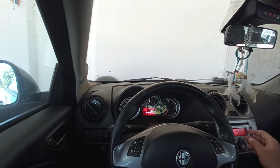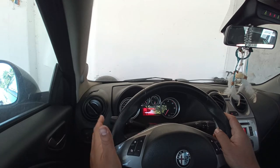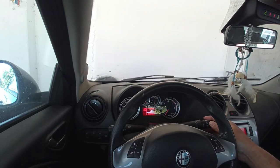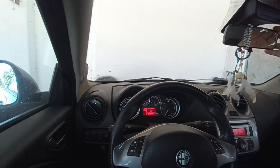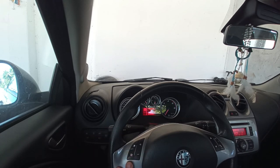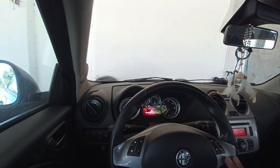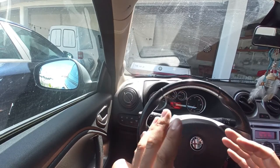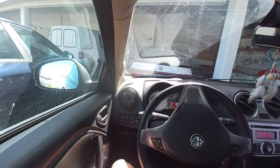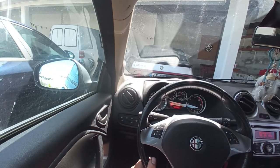Make sure the stereo works and no fault codes are active. Make sure all stalk functions work: indicators, high beam, low beam, presence lights, washers — front and rear. All functions are working correctly. The stereo buttons also work. Make sure to adjust your clock and date and every function in this area. Now we can do our test drive. No warning lights should be visible, and yes — we have power steering all the way through. Make sure to program the frameless windows — I have a video for that in the description.